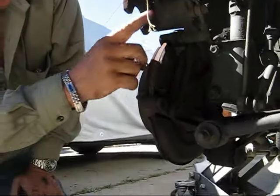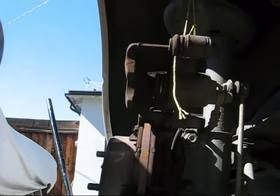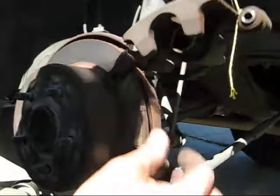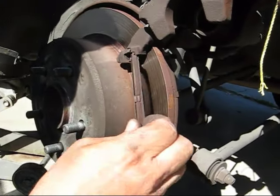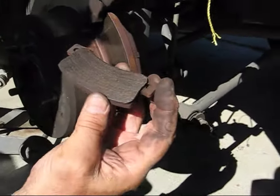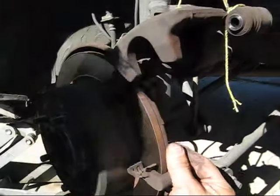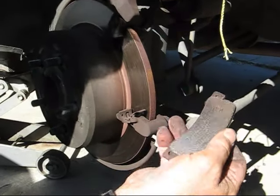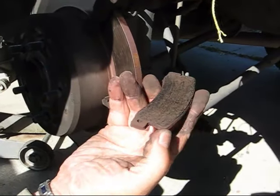Here is the piston. Let's just take the brakes off first. Here are the pads — look how simple this is. Now you know why this is squealing: there is nothing there. Maybe you've got a fingernail left. This side just pulls right off just like that, and this one is no better. This is getting the maximum life out of your brakes, but we're going to put new ones in.